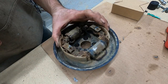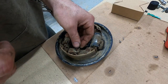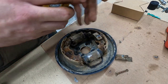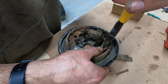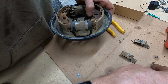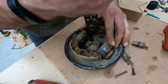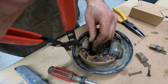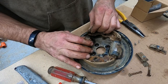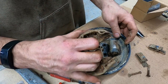There's not much to replacing these drum brakes. We just push down this little spring, turn the rotating pin, and it'll drop - that little tension spring will come out. Don't lose your little pins. Do the same for the other side - push, turn, and release. We'll clean all this stuff up before we put it back together. Old spring - the new brake pads come with new springs, so we don't need to keep these. Take that guy out, that guy out, that guy will slide down, and there's our old brake pads - out and free.